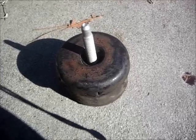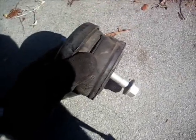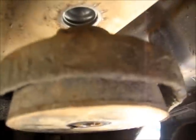Well, this is Sunday, the week before Christmas, and I'm working on the wagon. Today I'm putting on new subframe bushings. A common modification is to use the subframe bushings from the rear portion of the Taurus made from 96 to 2007 in all four corners, because it's a heck of a lot more substantial looking than what they put in from the factory.